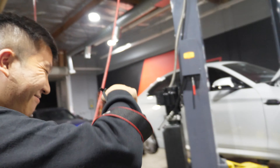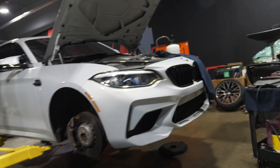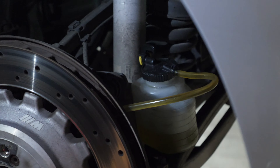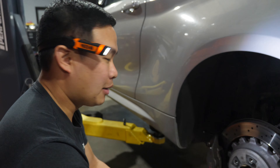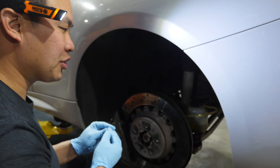I'm getting a shot of getting the shot — I'm just nosy. This is all I do when I'm here, just go up in their business. John, why is his head stuck in the wheel well? You have the little container for the brake fluid to bleed out. Is it two outlets? Yeah. You always want to bleed from the inside one and then to the outlet, doing it furthest away from the brake fluid reservoir — though depending on the manufacturer, some choose to start from the front depending on how their engineers designed it.